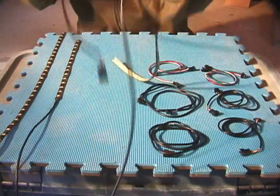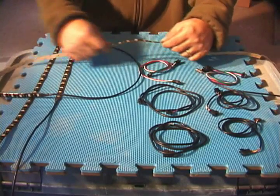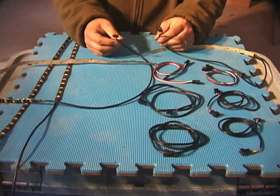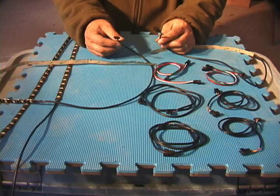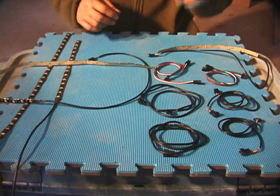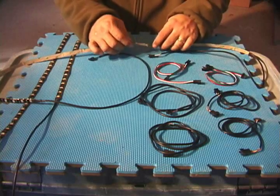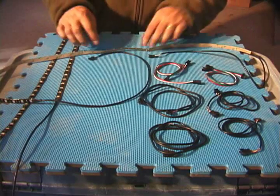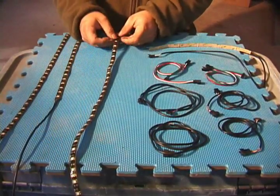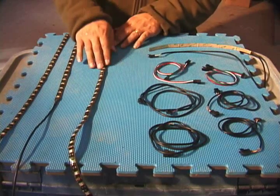Normally these would be a three-foot LED light strip. These particular ones come with a male and female end, so you could daisy chain them together if you wanted. But in most cases you'll end up measuring the best place on your running board where you can get the most continuous length without obstruction and then cutting it to length. I got 36 inches in a strip and cut mine down to 27 inches, which met the space I had on my running board before I came into a bend or a turn.